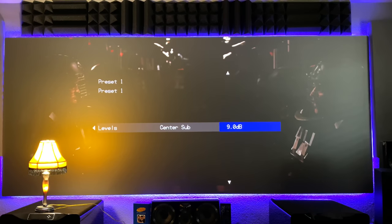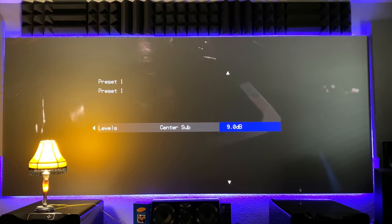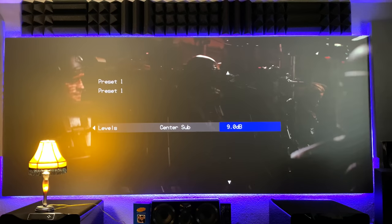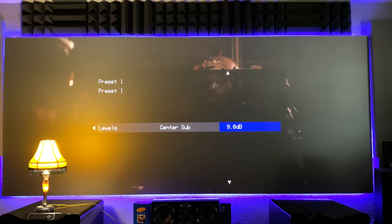That's basically how you set the levels for a subwoofer — whether it's the THX setting or the normal setting, whether you have a Monolith subwoofer or not. Note that auto-calibration like Audyssey can sometimes get it wrong — typically Audyssey is searching for 75 dB as a reference mark. If you want to run it a little hot you can, but this is specifically for the Monoprice THX certified setup. This process can also help anyone double-check their auto-calibration to make sure it was accurate.